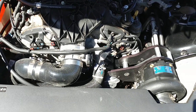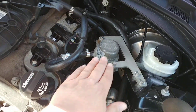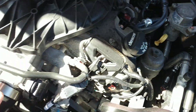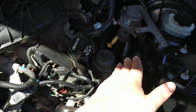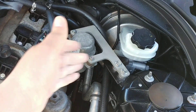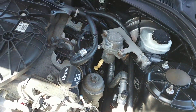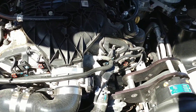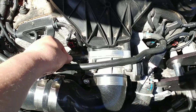Just to go through a few small examples of that: I redid the lines. This is the brake vacuum pump that normally sat at the front of the engine here, but because of the intercooler piping, I moved it up to here. I just had to redo some of the lines with the check valves and whatnot. Something as simple as that I discovered.